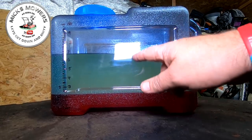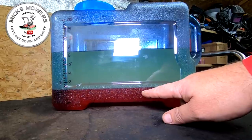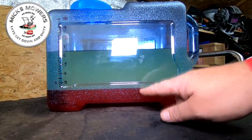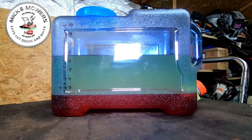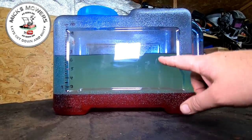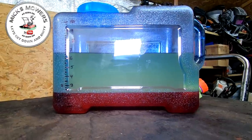You can already see the line has risen to just over two litres — it's already started reacting. But you want to let it settle and you'll see a definitive line later on. The two lines will be petrol on top, and water and ethanol in the bottom — because ethanol is attracted to water. Once done overnight, we should have ethanol-free fuel on top and water and ethanol in the bottom.